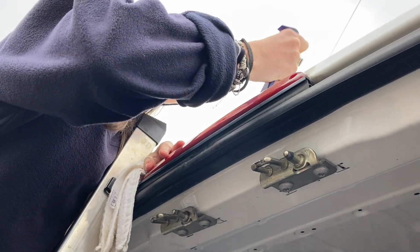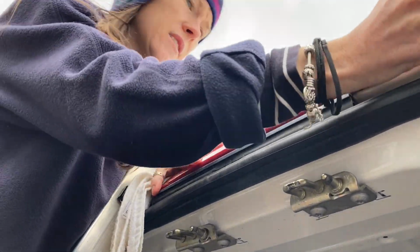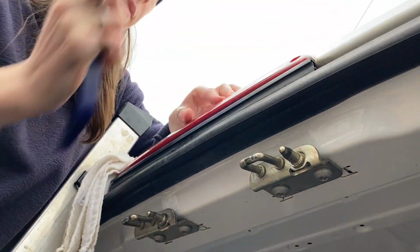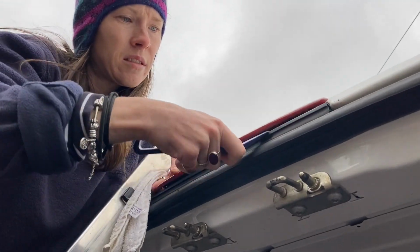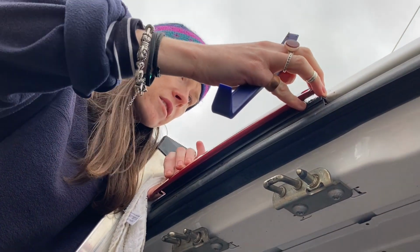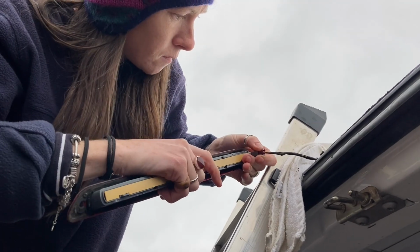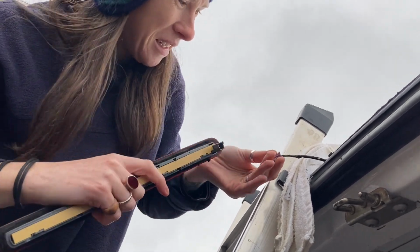Fortunately, the first part of the installation was relatively simple and involved taking off the existing brake light by removing its two screws. Sliding a trim tool around the edge cuts the waterproof seal which holds it in place. A little wiggle and you can then unclip the light fitting, and you're ready to switch the old brake light casing for the new camera casing.